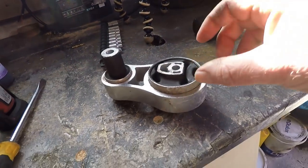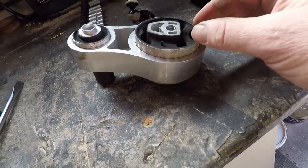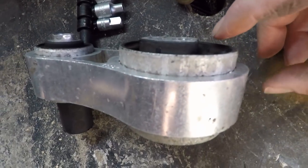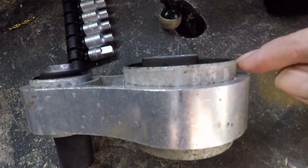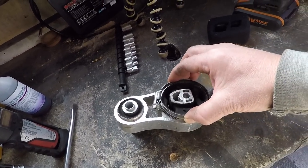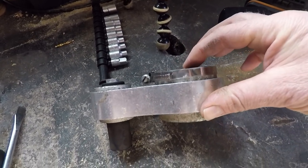When I put it upside down and pour down, that will try and contain it. But I want it to overflow so that it's not just filling the voids - it needs to spread out so it can't come out. If you look at this - I tilt it - you can see that the bush is set back from this upper rim. So we could flood it to this level and then get a little bit of an overlap. I'm also considering using a jubilee clip, sealing that on raised, and flooding it up to the level of that outer mount point.